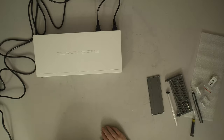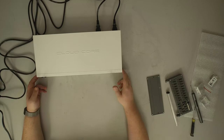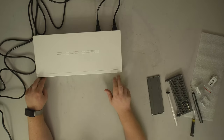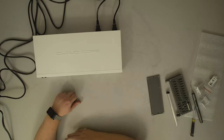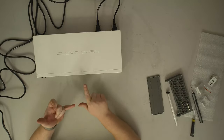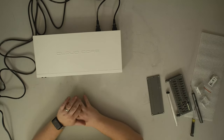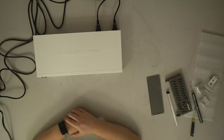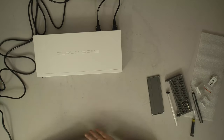As we've covered more networking gear, I definitely wanted to highlight some of the things that networking gear would normally talk to. Now, this device doesn't have 10G base T, and most of the networking stuff we've talked about does, or is 10G base T or 5G base T. But what this does have is a pair of SFP plus ports, and in a small business, although this is overkill for that, something like the CRS328 that I have in my rack would be a perfectly acceptable core switch for a small office. It's got four 10 gig ports and 24 PoE 1 gig ports, and weighs in at about $350 and supports RouterOS level 5, which has got all your VLAN goodiness, and honestly, other than some of the VPN stuff that this is capable of, has everything uncapped. Not that the switch actually has a CPU capable of keeping up if I suddenly dumped 500 VPN tunnels on it.